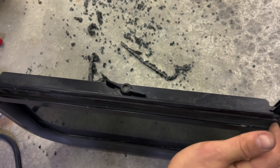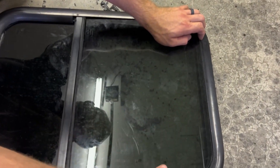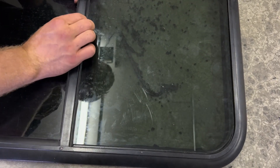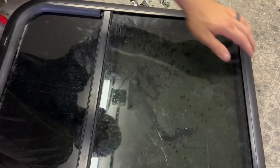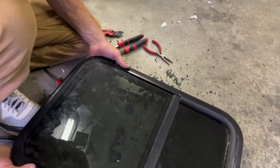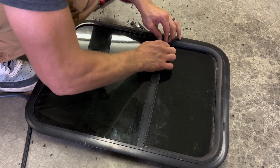So we got this trough cleaned out really nice. There are no chunks of glass in there that are going to get in the way of the new piece. This bottom piece of rubber is the difficult one and it's pretty important because the rain is going to run down this way — that's why it's so tight and has proved to be difficult. I tried it multiple ways, but I think the best way to go about it so far is putting it slightly in as you slide the glass down and then pushing it down from there.